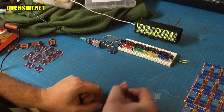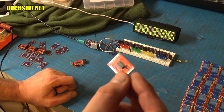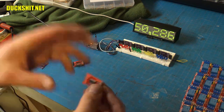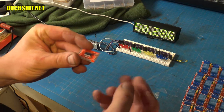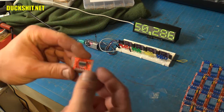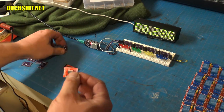completely forgot about it. You might remember last week, I had these little chips here that I was talking about. These little guys were the input chips. They can take 8 different switches inputted into this thing, and then sends little signals off to a computer. So essentially, it turns all my switches into digital signals, and it sends them as little blips, ones and zeros. Literally, it's a bit counter, if you will. 8 of them going across. And I mentioned that these little guys can be chained together.